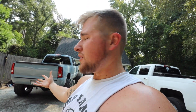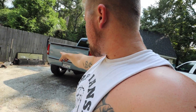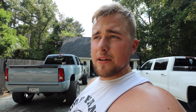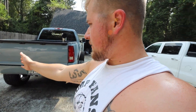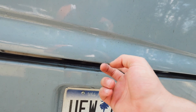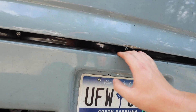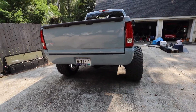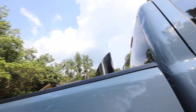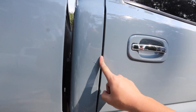I'm taking off this wrap, doing some body work, making sure all the body work is filled in properly, getting this big old dent out of the rear, then taking off this whole lower panel right here and doing body work on all this back end. Then we'll be rewrapping just the rear end. I drilled the holes and I have to lower the roll pan just a tad bit to make everything work because it's hitting right there — it's just raised up. I'm gonna unscrew these screws, get a hammer, knock it down a little bit and screw it in lower, and that should in theory work out pretty well.